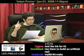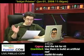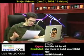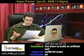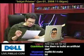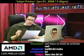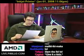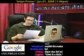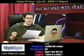Number one: slam the lid. While this may sound violent, it fixes the classic 'my printer won't print' email that I often get. Some models of printers, specifically the HP DeskJet 5650, have a lid that sometimes just won't shut firmly — sometimes it closes slightly off-center. A firm closing of the lid that covers the ink chamber tends to fix it. It also gets a comical reaction from the user when they think you're going to work some techno magic and end up fixing it with a caveman approach. Check the lid first.